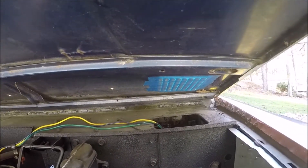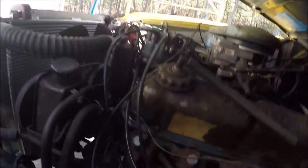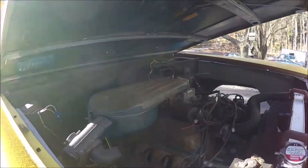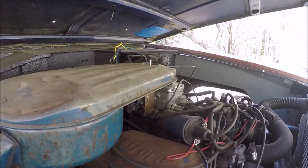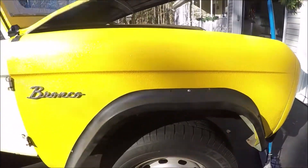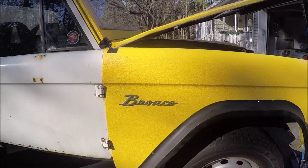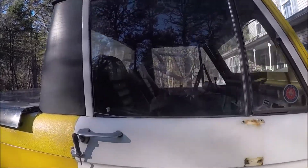New firewall too — that's going to save me a lot of time; it was just rusted out really bad. Typical 302 motor. You can tell half the manifold bolts are missing. New plugs, new wires, new coupler. Like I said, the only wiring hooked up is to the ignition. Not really sure if the coil is supposed to go right there — I'll have to Google that. Overall, not too bad. Bronco enthusiasts know these trucks go for 12 to 15 grand, and I didn't pay anywhere near that.